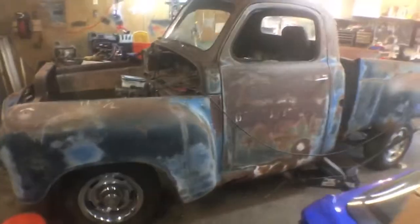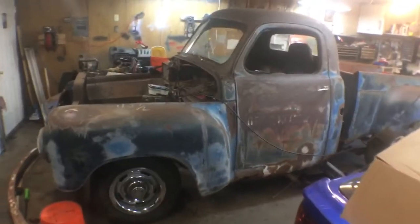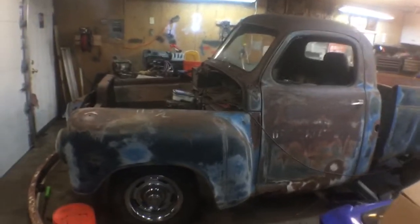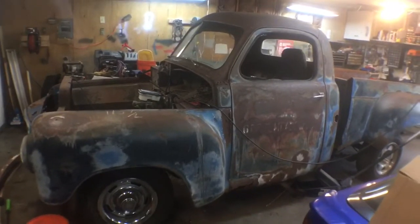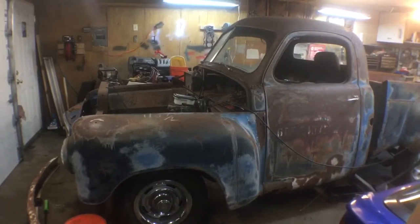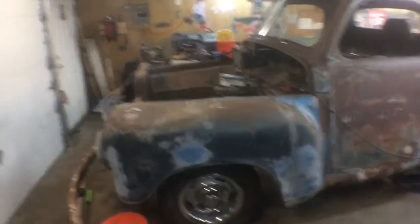So I loosened up the cab mounts and I started jacking it up. I jacked up the back about 3 inches and I didn't like the cab mounts at all, and it was sitting really high. I want this truck to sit kind of low, it's two-wheel drive. So I realized the front couldn't come down any further